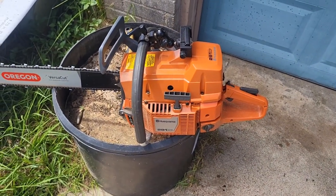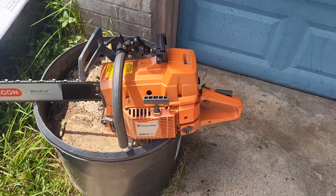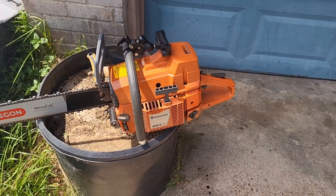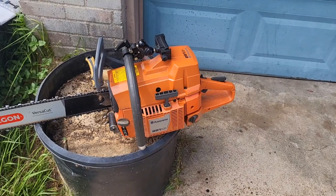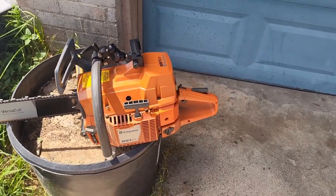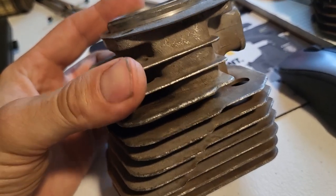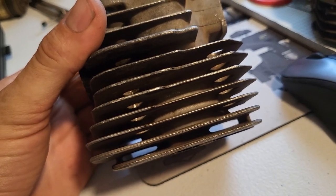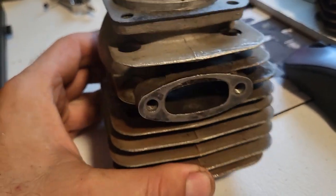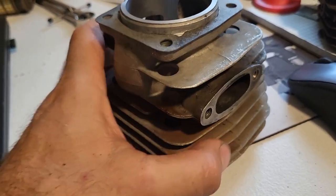It feels like it's got a little more snot with the timing advance. It's about half the key filed off — I measured it with a caliper, didn't check fins or advance or anything like that. The 288 didn't really pick up any time with the advance; it felt like it was starting to have a little more heat than it did prior to that. So I'll probably just shim it back the 10 or 15 thousandths — grab a feeler gauge, cut it back, and put it back to where it was.